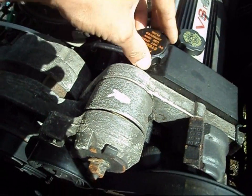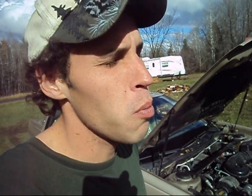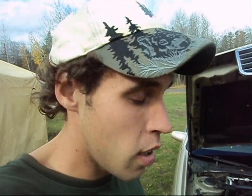Fluids should be at the full cold level — we're good. When it comes to checking engine coolant, I usually check it in the fall after deer season, and there's a reason for it: hunters are chasing deer out of the bush, and deer can really make mincemeat out of your radiator — I know that firsthand. I usually check it around mid-November, and then in the springtime, usually April, I check my engine coolant again for boil-over protection, to make sure it isn't so lean that it'll boil over at normal operating temperatures. Twice a year — once in spring, once in fall — check it, top up your rad if necessary, and you're good to go.